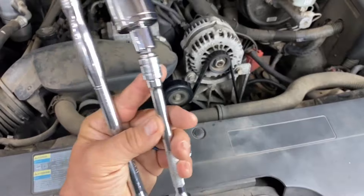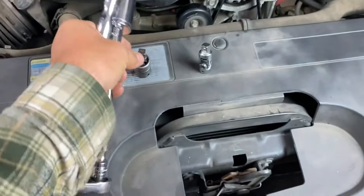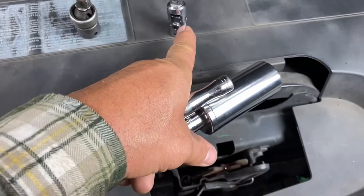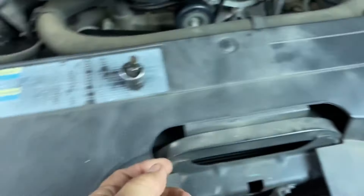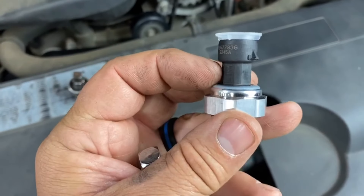I had to use an adapter because I've got a half inch socket. The other option instead of using this little flex is to use a swivel, which is this right here, or you could also use a universal — but I don't like using the universal so much. You can get in a bind and actually end up breaking the sensor, and I don't want to take a chance on breaking this plastic, even on an AC Delco.